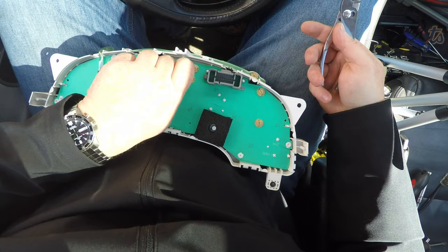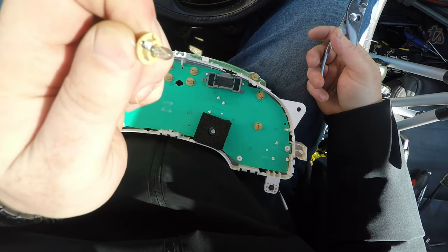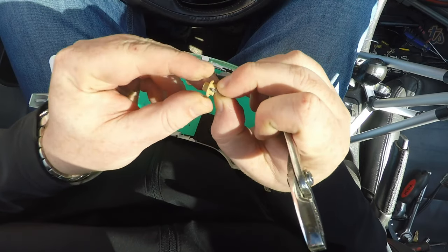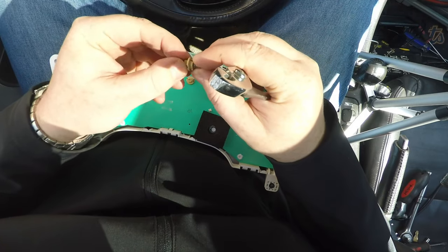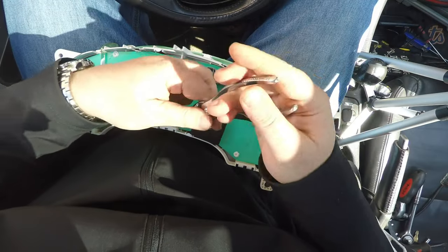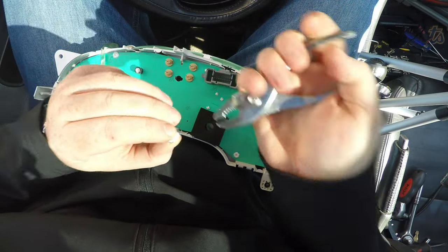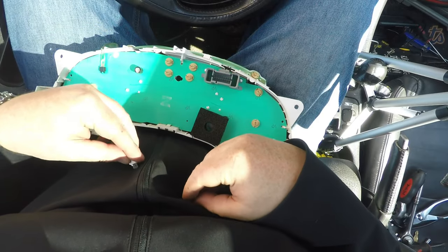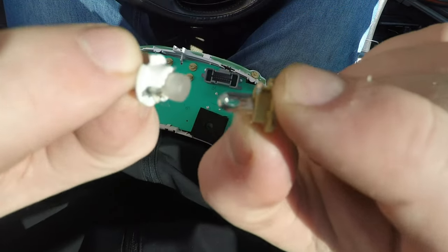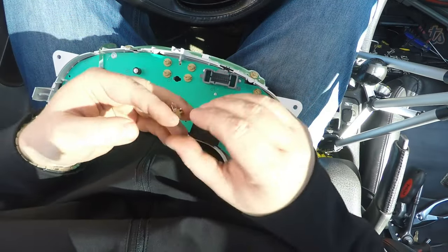You're supposed to do them by hand as best you can, but some of them are hard. They're just little tiny things. Not all of these are burned out — in fact this is a good one. I can't get this one by hand, so I'm going to use my pliers — twist it gently until it comes out. This is the standard incandescent; this is the SMD — you can see the difference. This one's bad so it goes in the scrap heap.